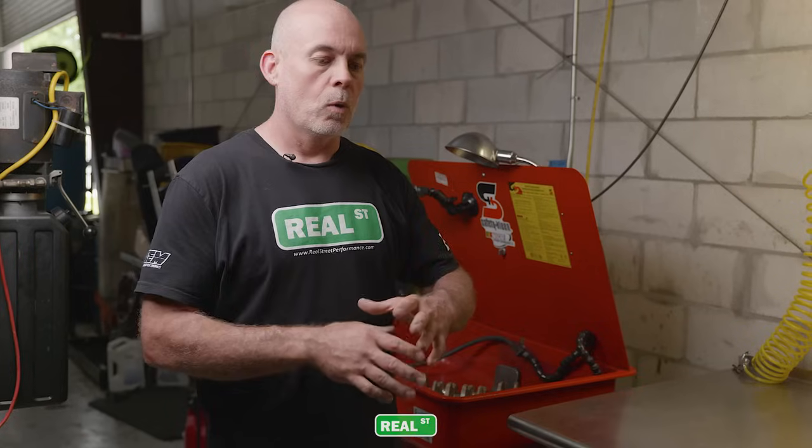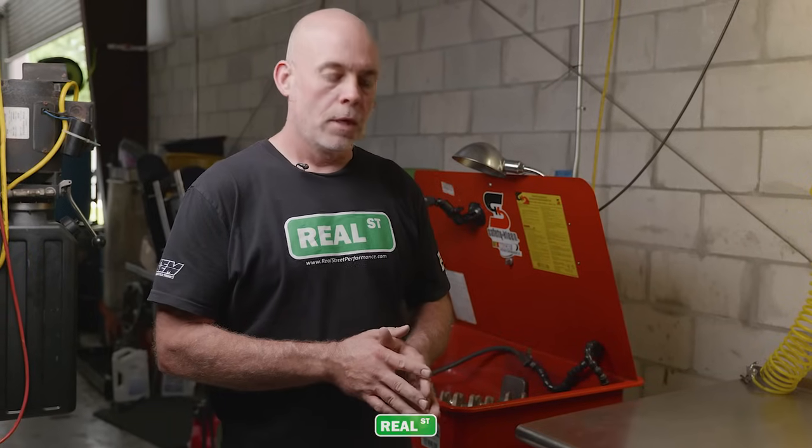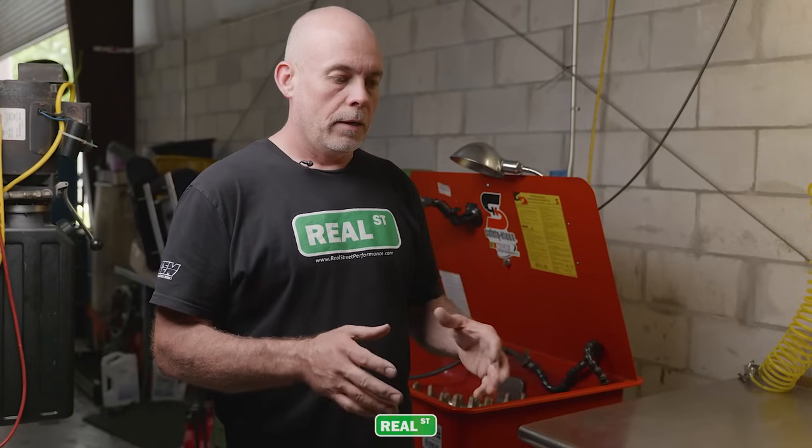And we're going to be aware that corrosion is still an issue, so things like the piston pins can flash rust. Any cast iron or steel machine surface needs to be cared for throughout this process so it doesn't get corrosion on it. Very small amounts of corrosion can lead to big problems, so you're gonna work quickly just like you did with the bores, and you're gonna be aware that cleanliness is the best case scenario.